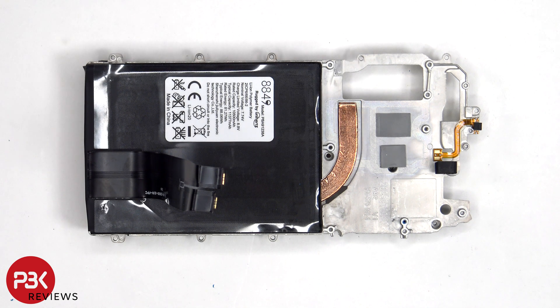There is also a copper heat pipe which runs in between the batteries to help transfer heat. And this flex cable is for the infrared or IR blaster. There are also two thermal pads on this midframe, which sit over the processor and RAM to help transfer heat.